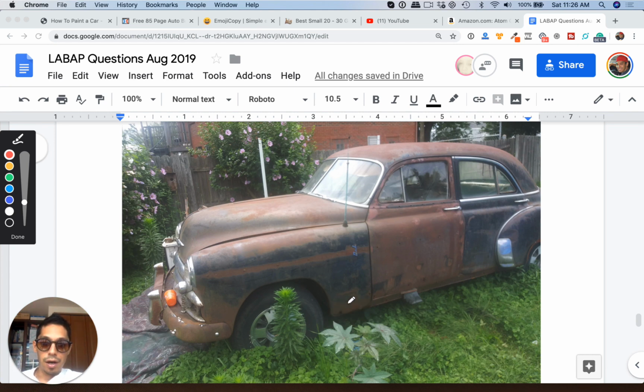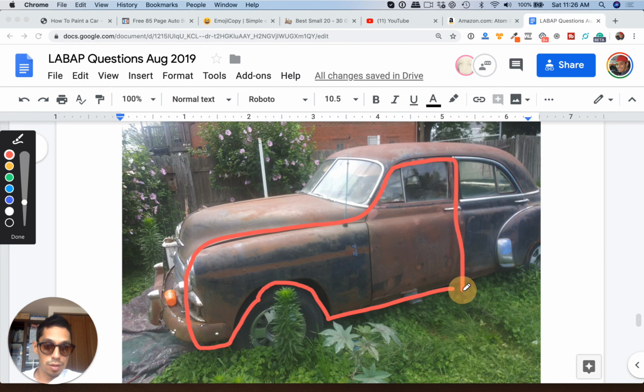Then the next day, you could get it done as far as body working, putting a coat of filler on top of it and getting it ready for primer. Then the next day could be doing this door, sanding it all down, doing the body work, and getting it ready for primer. Third day, I would just epoxy prime the two pieces. This way, that's primed and done.